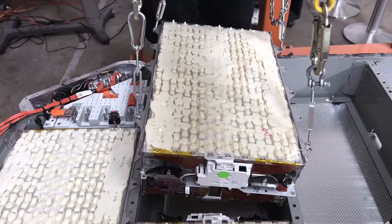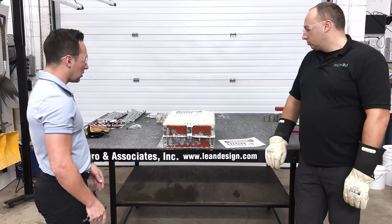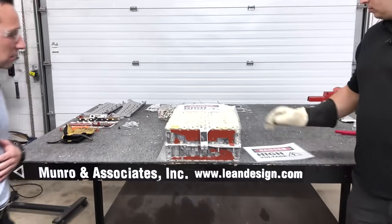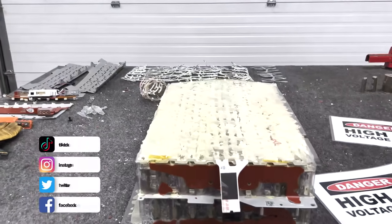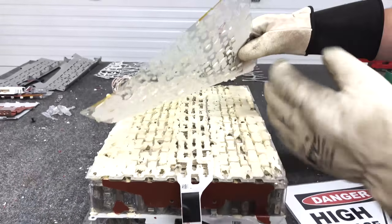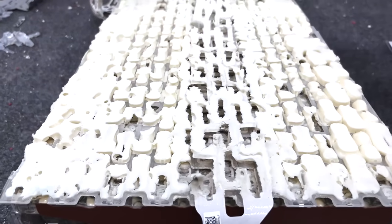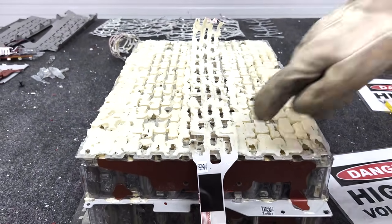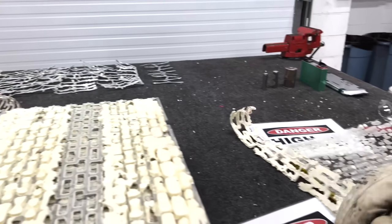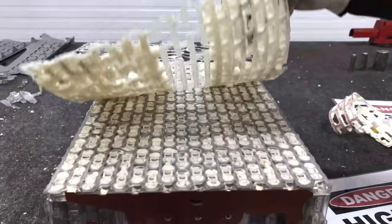Antonio helped get these modules out of the battery pack and we've been looking at this a little bit. Let's work our way down this deconstruction. On top, there's a protective plastic film which just keeps anyone working on the module during installation from encountering shock hazards. You remove this and we encounter a voltage sensor harness, which is easy enough to peel and remove. Then we have a protective nylon cover — we'll have to check that.